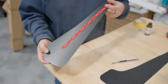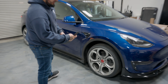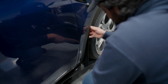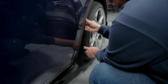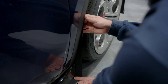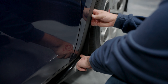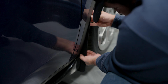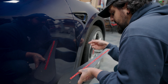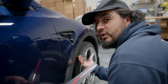This is how much tape you need. Before removing the protective cover, you can line it up first to check placement. I'm going to line it up to see where I want it — the top needs to be somewhat flush, and I'll go about an inch and a half down. Once you have it lined up, cut off any excess 3M tape. Before you apply it, you are going to want to clean off the area. If it's dirty, the tape won't attach well — it'll just pick up all the dirt and fall off.